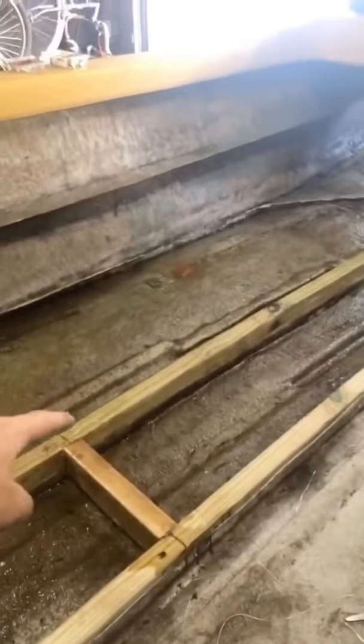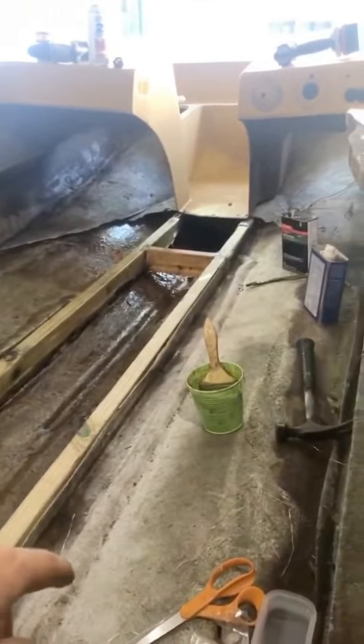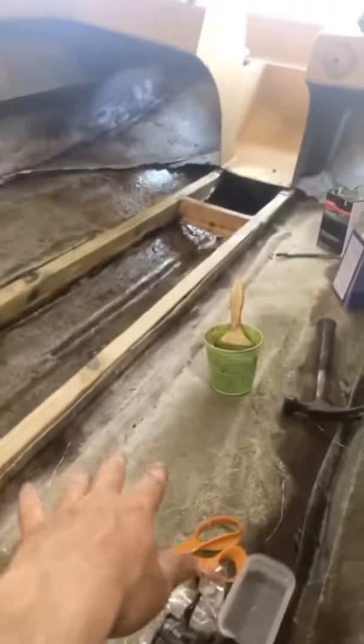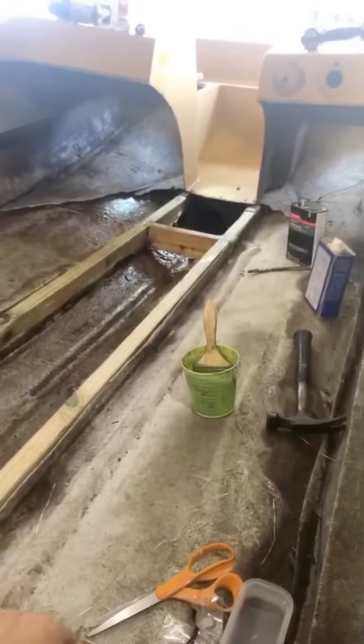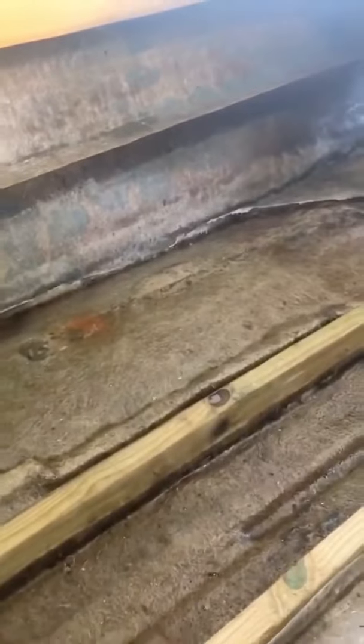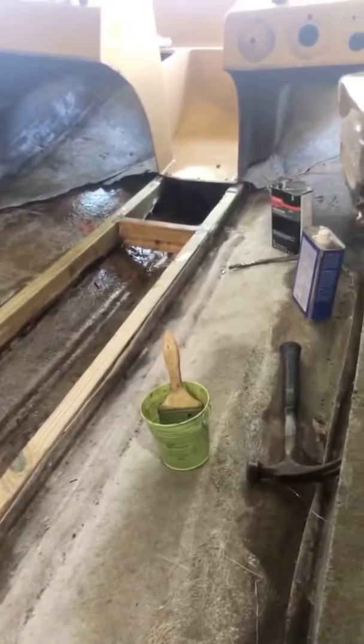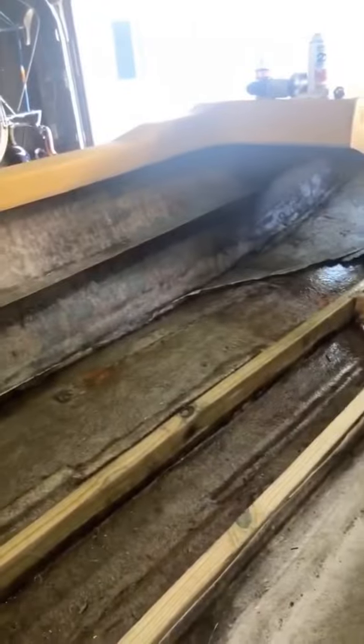So this has fiberglass. The farm one has fiberglass on it, and this one doesn't. I ran out of fiberglass resin. You can see this is really light because it's dried out, and it's just missing a lot of resin, being from 1973. So I also threw a bunch on that side that I thinned out, so hopefully it'll just reinforce the hull and seal everything up.